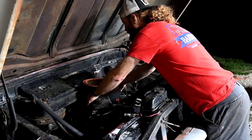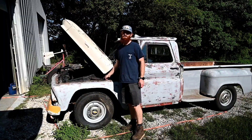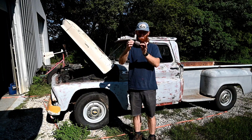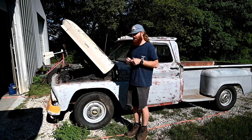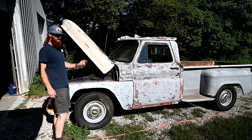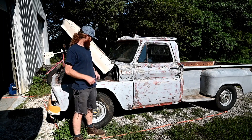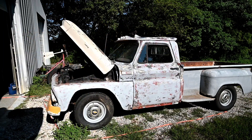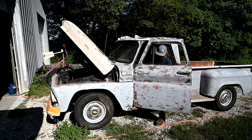It is the next day and we're back out here. Hopefully you can see in the light what we're picking up in this fuel filter — it is pretty nasty stuff. For the most part that tank probably needs to be changed because it's got a lot of rust sediment in there. I charged the battery all night and hopefully that's going to be up and ready to go. Let me get the key and see if we can't fire this thing up — I'm going to try to pull down and do a better burnout than I did in the 'Will It Run.' Yeah, that's running a lot better already.